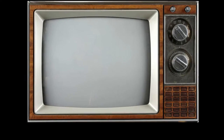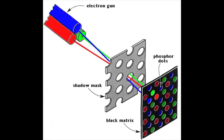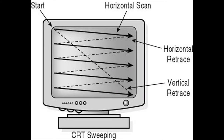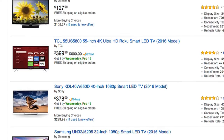But exactly how did these things actually work? The developers knew the one thing that would allow it to work for most people at the time was the predictability and consistency of CRTs, or cathode ray tube televisions. The one thing all CRTs of every brand have in common are the guts inside that allow it to work. Nintendo understood that the best way to make this product work for everyone was to utilize the CRT's technology — more precisely, to utilize the phosphors hidden behind the glass screen itself. Regardless of the frame rate or whether you're broadcasting in NTSC or PAL, the signal still sends and receives in lines of resolution. You ever heard of 1080i or 720p? That's a reference to lines of resolution.